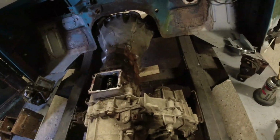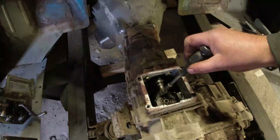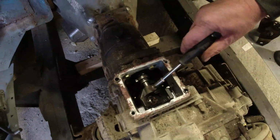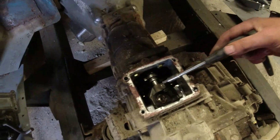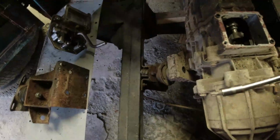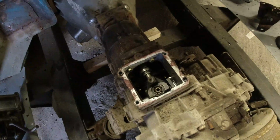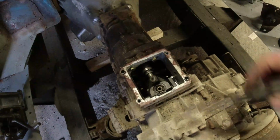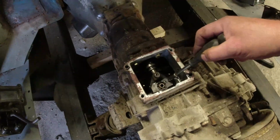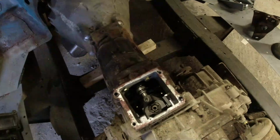Just now, I was using a T drive, a Torx drive, and I got it hammered in there, and I was turning it around, and it was starting to turn. Luckily, it's magnetic. As you can see, it's just picking up bits of unhardened steel. The grub screw is non-hardened, which is great. That's outstanding. Thank you so much, whoever built these things. Anyway, it'll come out. It's got to come out. There's no choice in the matter. It's coming out.